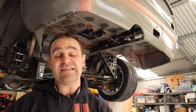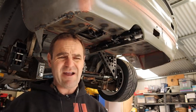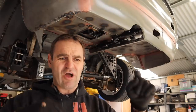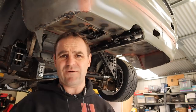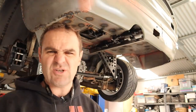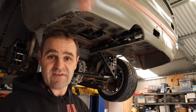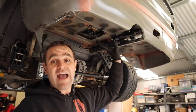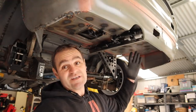The Ferrari had that as standard. There are actually a couple of bleed nipples on the Ferrari fuel rail to get any air out, but I imagine as soon as it gets under pressure and opens a few times — even if it's opening dry — it'll let the air out, fill up with fuel, and the car will burst to life. That's how the car ran from factory, and that's how a lot of factory cars run these days.